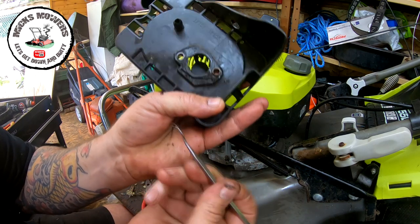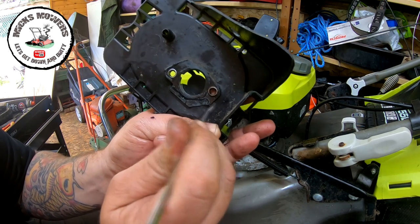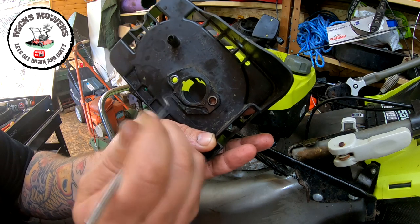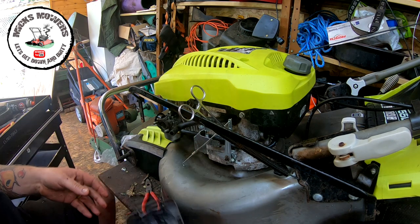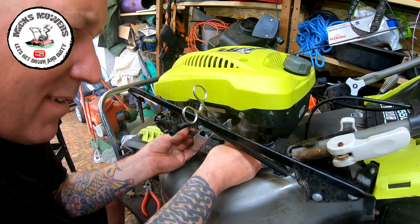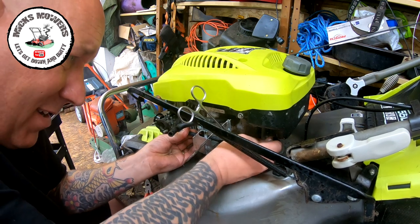In here is where your primer primes all the stuff and there's gasket glue in there - see that? That's why that was blocked at the back. I can't have it in there - we need that, that's how you prime your carburetor. It was priming. So now I need to see if I've got enough fuel hose here. I think I possibly have - I might have to drop this off a touch off this tank.